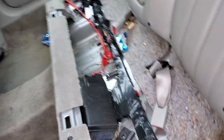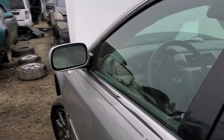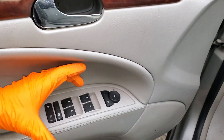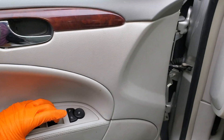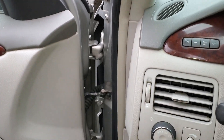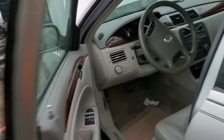I hope this info was helpful for you. Please be sure to let me know if you have any questions. One other thing I can add — every time you open and close the door you're flexing some wires in this area and they can wear out. So one thing I like to do before I start removing door panels is I'll hold the switch in a certain position, open and close the door, and see if it responds at a certain position. If it does, then I might suspect that a wire is making a bad connection in there. Thanks for watching.